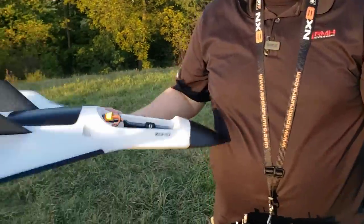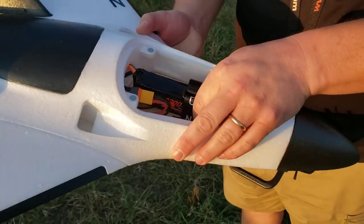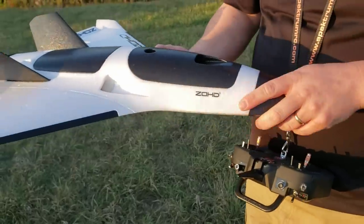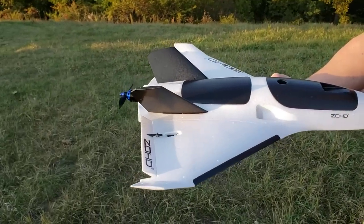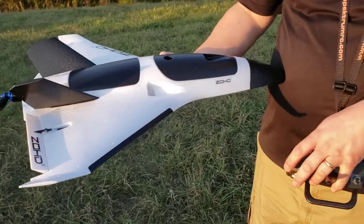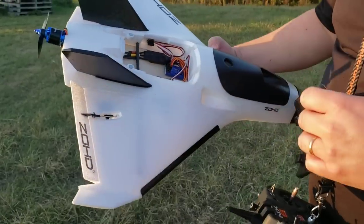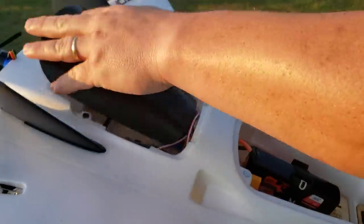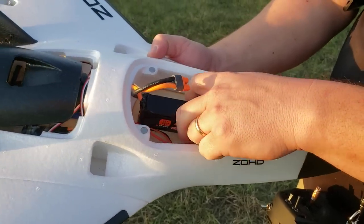The motor is actually running — it was so quiet. Battery shifted, probably only on landing. I could probably position it like this to get a little further CG on the tail. I'd like to see what battery charge we have left — those elevons are in that upward position, which is very weird. You're supposed to be able to reset that. Are we legitimately out of power? It's not responding to anything except the stabilizer. I'm going to unplug this and de-energize it, then check it with the XPC 100 battery checker.